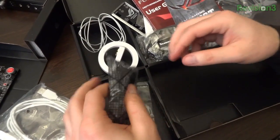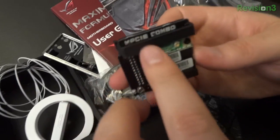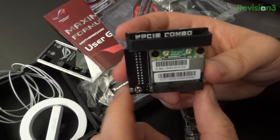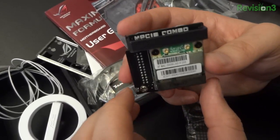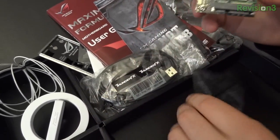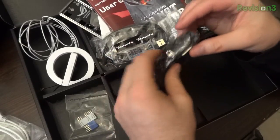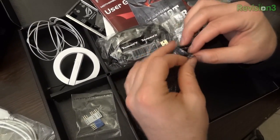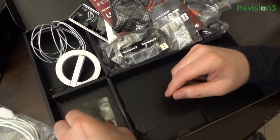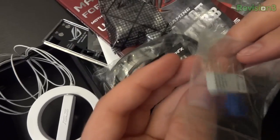You've also got a Thunder FX USB so you're fully ready to go with your Thunder FX card. This really cool little feature right here is called the MPCIe Combo Card — a unique little interface that gives you expandability options. You're actually going to be able to put a little mini PCIe SSD in here to help with boot times and give you a little boost. I'll go into more detail on that in the actual build video. You guys know I want to do an SSD RAID, and I might also put some large traditional hard drives in there for media. The last thing in here are your little power, ground, and reset plugs.